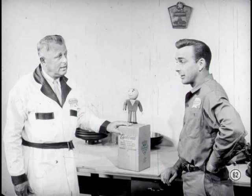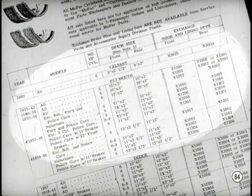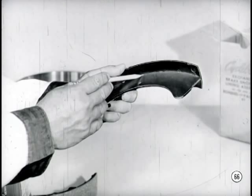Let's talk for a few minutes about relining brakes. We use only Chrysler-approved shoe and lining sets, all ready to install. For several good reasons: first, we'd have to buy bonding equipment, and that's expensive. By using shoes already lined, we're sure to get the correct type of lining for the job. Also, it saves a lot of work because the linings are pre-ground, so they fit the contour of the drums properly. And that means you don't have to worry about the quality of the linings and how they might fit the drums. We just can't take any chances with our customers on questionable parts, particularly shoes that are not properly heat-treated or with poor welding jobs.